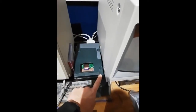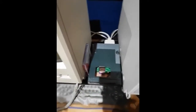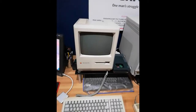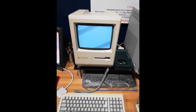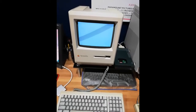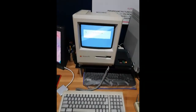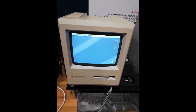I've also connected the LED from the Jaz enclosure to the board, so it should work fine. There's a zip disk here just because I was using a zip drive before — it doesn't relate to this solution. So, powering it up. It takes a while to boot because this Mac has been enhanced — I upgraded it to 4MB — so the POST tests take a while to complete. It's working perfectly fine; it's a beautiful machine and I will keep it basically forever. As you can see it's booting and using the SD, and you can see how fast it boots.